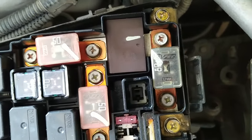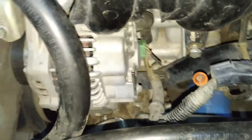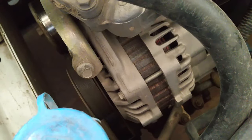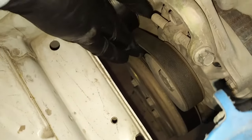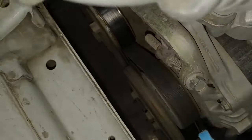Visually inspect the fuse. If it's covered, you can check it with the help of a test light, which can also help check for power in the clip. Check for a worn out or broken drive belt, and adjust the tension if the belt is loose — slippage causes friction and generates heat, which will glaze the belt and further decrease its gripping ability. Tighten any loose alternator mounting bolts and brackets, as vibrations from that will lead to alternator damage.